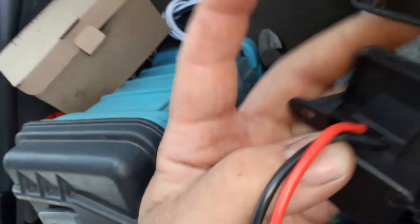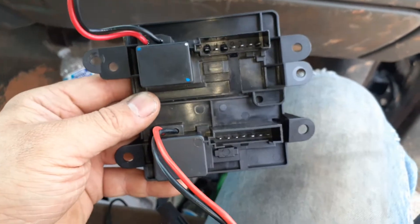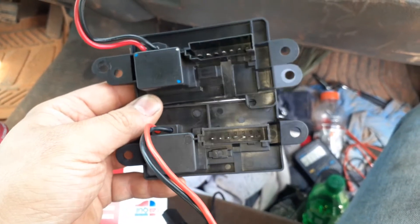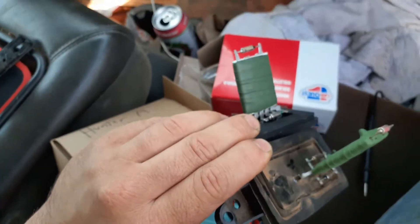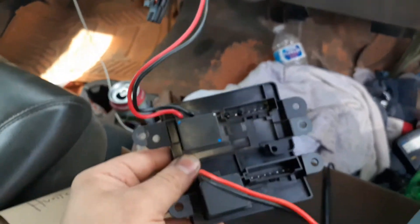There is also two-hole and four-hole versions. You can see four holes on top and two holes on the bottom. Look at the one you have first before you order one or go to the parts store, so you can make sure you get the right one. The tops vary depending on manufacturer — don't worry about what the top looks like. The main things you're looking for are: is it for automatic or manual, and what's the number of holes?